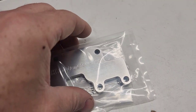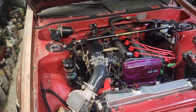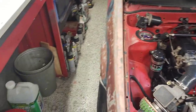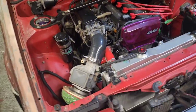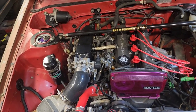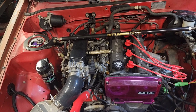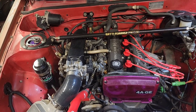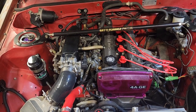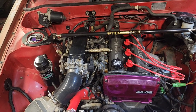Alright. So, one thing I've been dealing with on my 86 is a high idle issue. Done all the things. Replaced the intake manifold gasket, new TPS, have done everything aside from fogging it. Actually, I did smoke it. No, couldn't find any leaks.